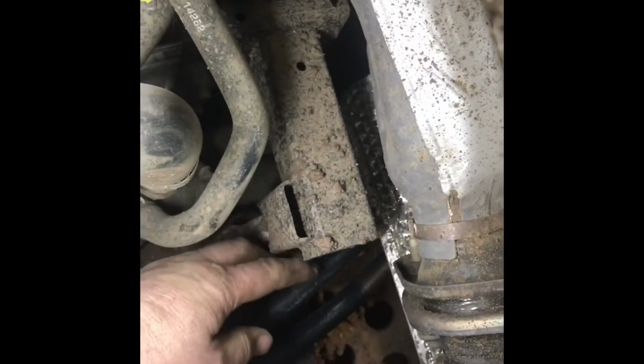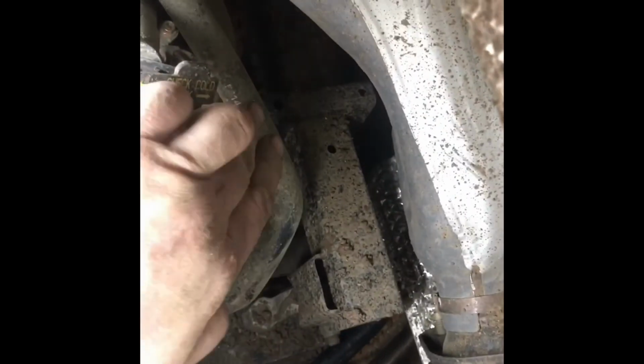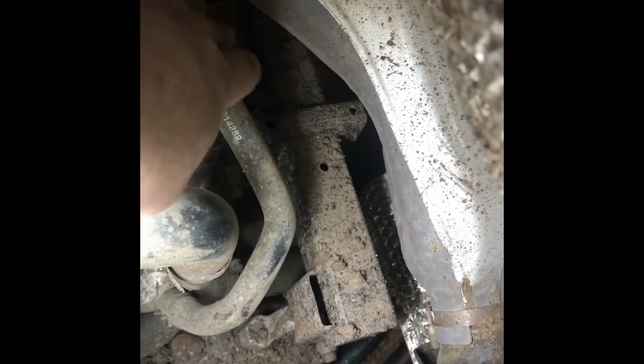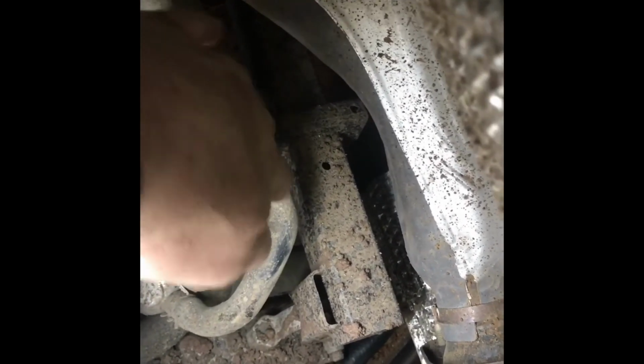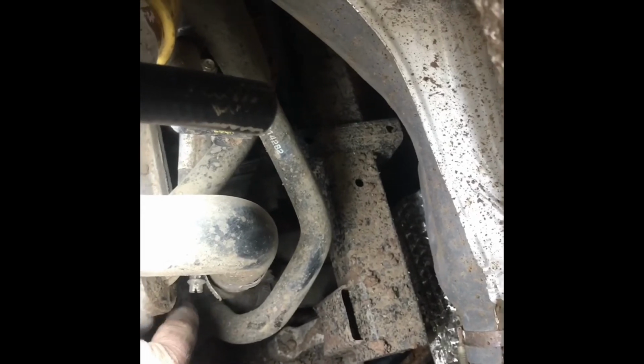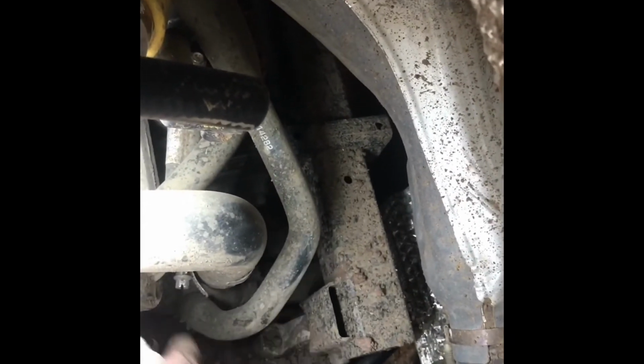Okay, I've done a bunch of these, and what I like to do is, with the inside hose, run it up, and we're going to cut this right here, and we're going to keep this side of the hose, splice, and then hook into our new heater hose. And the hose closest to us, that runs directly into the water pump, and this little section of hose here, I just discard it because that one will come out here.